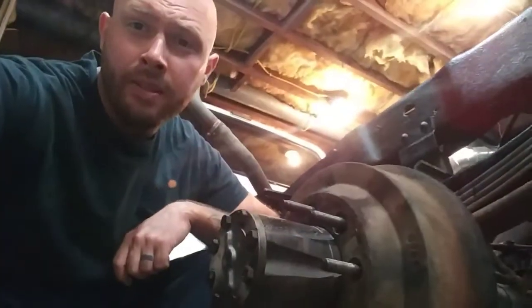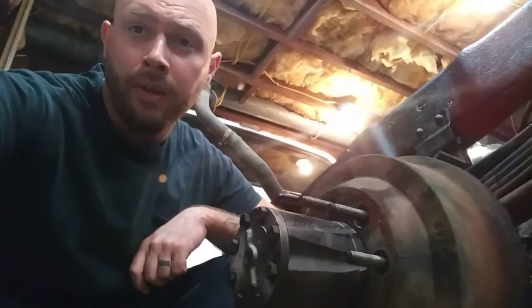In basic terms, I just explained what a full floating axle is. On the green truck I showed you, that is a semi-floating axle — it technically can't carry that much. It's just a pickup truck probably rated to carry maybe a thousand pounds if I looked at the sticker, before things start to squeak a little bit.